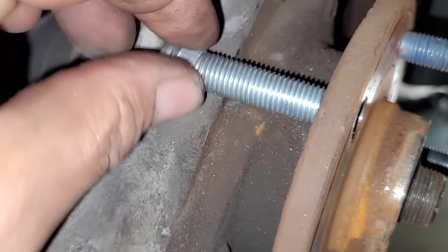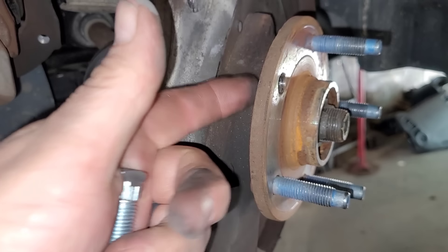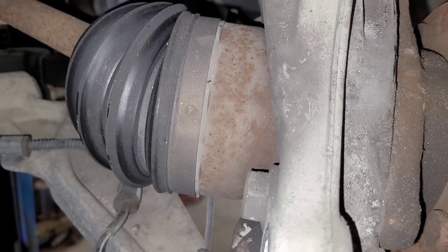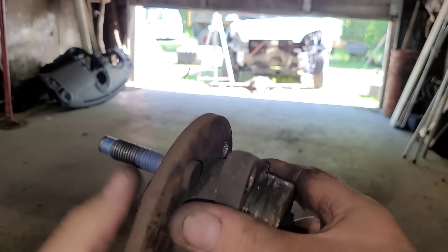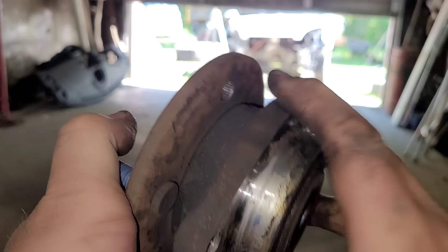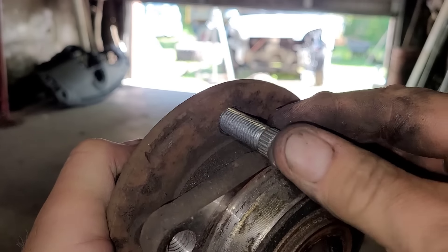I'm going to go ahead and unbolt the hub, and hopefully the hub itself will come out a little bit. Once it comes out and cocks a little bit, I should be able to get the stud in there. Those look like 18s — it's amazing they use these gigantic 18mm headed bolts on here, but then on a truck they use like a 13mm head. So I wound up having to take the whole thing out. It feels nice, smooth, tight — there's no play to it. So it's just going to get a new stud. See, they actually put a notch here — a little divot — so you have a recess to get the wheel stud through.